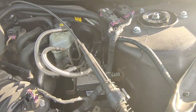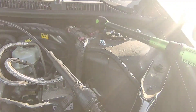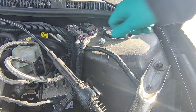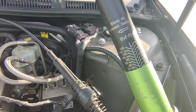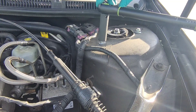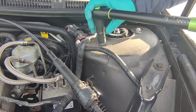Now we're going to do these right here — these are the top strut torque nuts. Those go to 24 foot-pounds. Let me set the torque wrench here. It's very easy to operate. That's 24 foot-pounds right there — very easy.